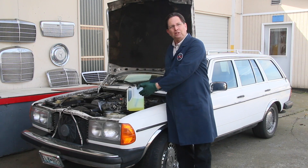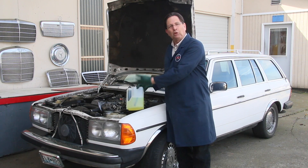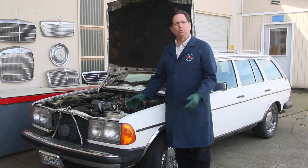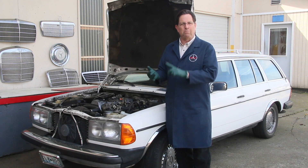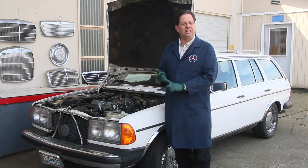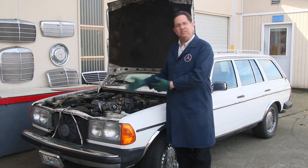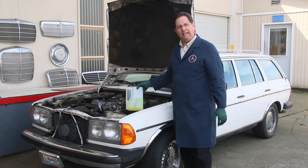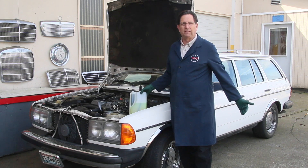This is our emergency fuel tank and also our diesel purge tank. This tank will also allow you to run a diesel on fresh diesel fuel, and you will literally bypass the fuel tank screen, which can be a problem. You'll bypass all the fuel lines and the fuel tank itself if you've got a venting problem or something else. I can hook up this tank, put fresh diesel in it, and within 10 to 15 minutes I'm going to know whether or not clean fuel is going to solve that smoking problem.